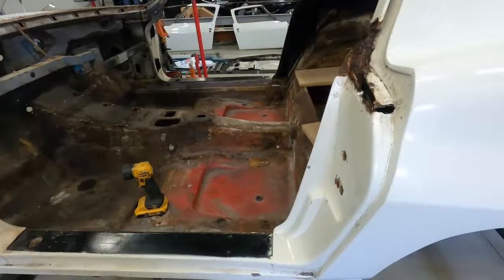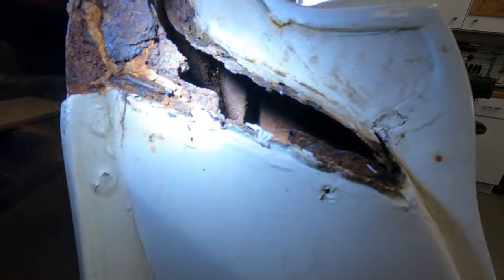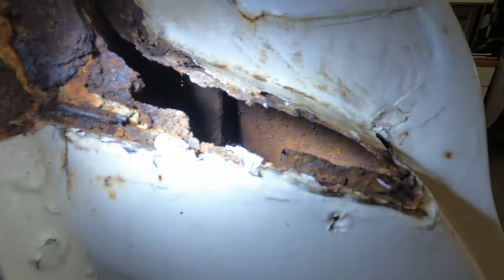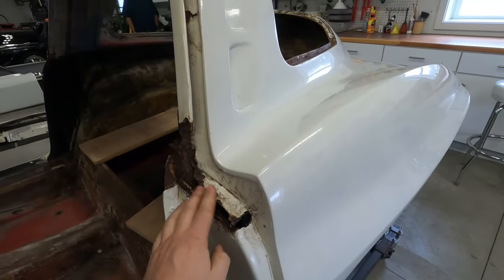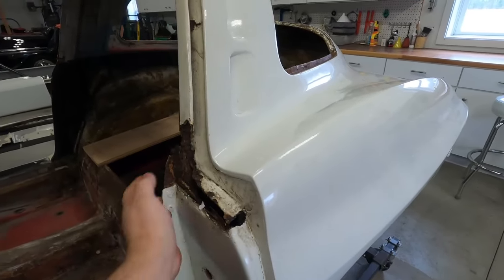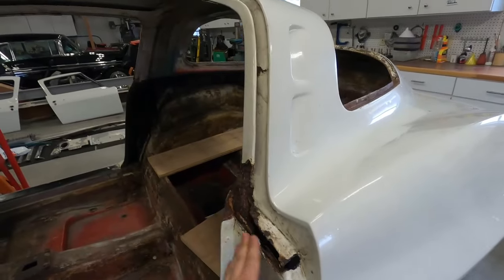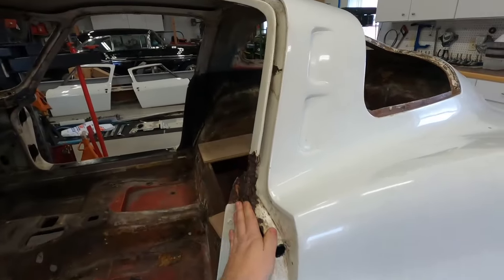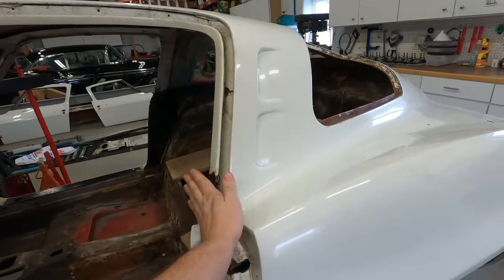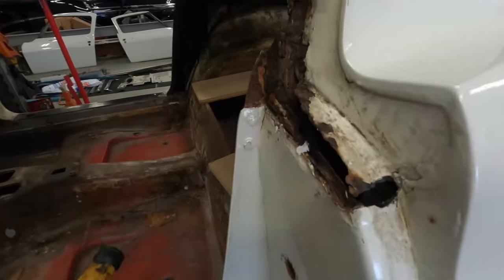This side is a little worse than the passenger side. You can see in here that she's rough in this area, which definitely means you need to remove the quarter panel, remove the B-pillar, and pull a gutter off to get access. You're going to have to do a lot of hand-fabricating. They don't make the piece that's damaged underneath — they make the gutter and the drip rail, but not the stuff damaged underneath, so that will need to be handmade or you'll need to find used parts. At worst case scenario you may have to start peeling up the rear tub a little to get access in there, because your bonding strips might not be attached to anything anymore. It's definitely a structural point in the car that you want to have in good shape.